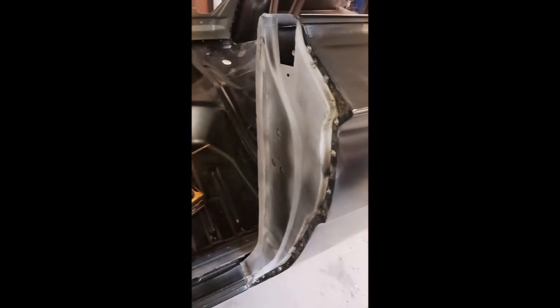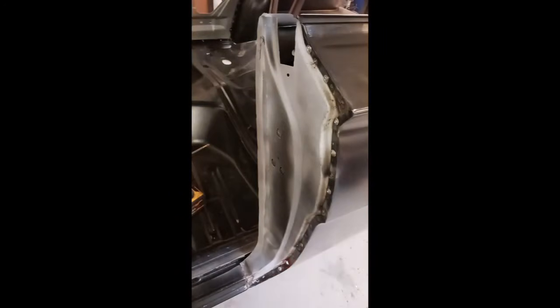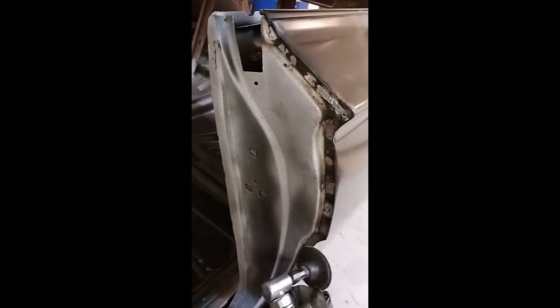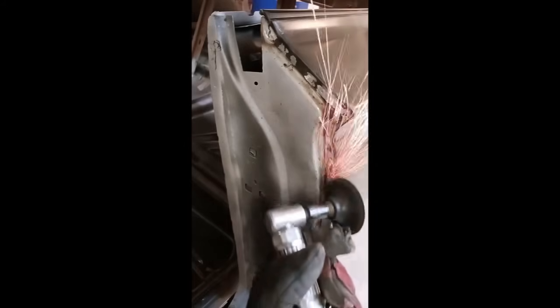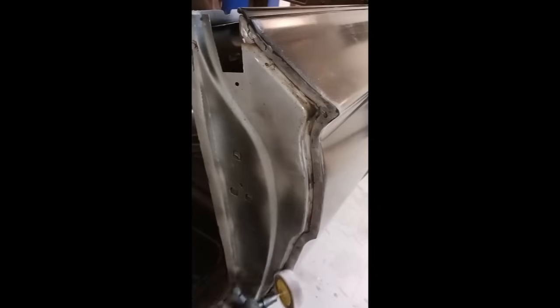And if we have our machine set right, now one step that I didn't show, we have a vacuum spot blaster that we use to prep that area. We already have the weld-through primer on the door jamb, and we have the EDP coat on the inside flange of the quarter panel. But I've shown that little spot blaster in other videos. There's no better way to prep for welding than that. If we have our machine set right, the fit up perfect, we can get really flat welds.